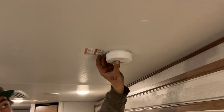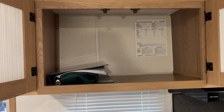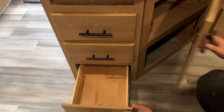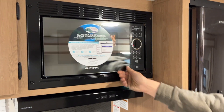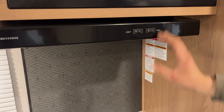Right above our heads is your smoke detector. Into the kitchen — your storage up top, you'll find that binder. That binder's got all of your owner's manuals, any remotes, and anything like that for the unit. Above the sink is a little light, and you've got hot and cold water, of course, with the mobile head and the folding sink cover. Drawer space beside it, as well as storage underneath. If you're looking to winterize the unit yourself, the hot water tank is just right back there with the bypass valves already on it. Down underneath the microwave, you get your range vent — the light as well as the fan. This is the fan you want turned on with that flap outside opened up to evacuate any fumes from your stove.